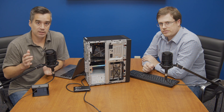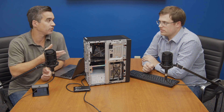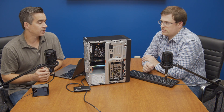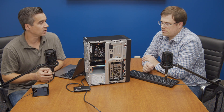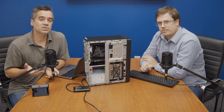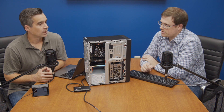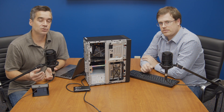It'll be interesting too because today WD also launched a Gen 4 SSD — available in a couple weeks in the standard version with the heatsink version coming out later next year. It's conceivable WD is building a platform where as they release new drives they can slot them in here. Two Gen 4 drives on the Gen 4 bus might be too much, but it still gives gamers access to the latest generation technology. If you have a native Gen 4 platform they have that covered; if you don't, they have this option. It's a neat but niche offering — if you want four terabytes in a performance drive you don't have many options, and the main one right now is a Gen 4 product which carries a hefty price premium.